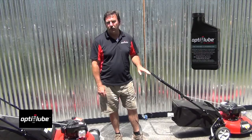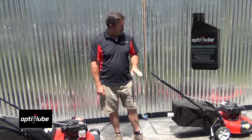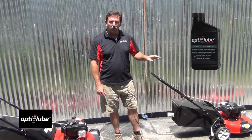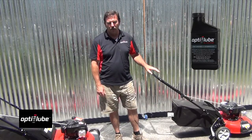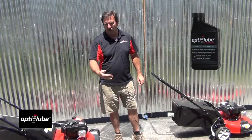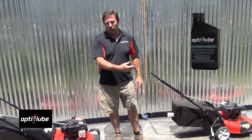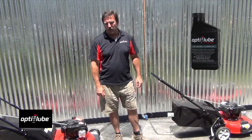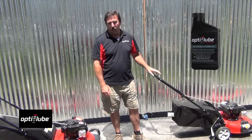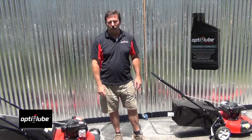We checked decibels all through the test — they were virtually the same. It didn't change the sound any, which probably makes sense. But the most important thing was we checked the heat with an infrared sensor all the way through. The last reading taken was 30 degrees cooler in the oil fortified lawn mower than the other one. Consistently it was at least 15 to 20 degrees cooler. So we know the motor is going to run a lot cooler, taking measurements at the same spot with an infrared heat sensor.